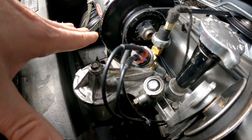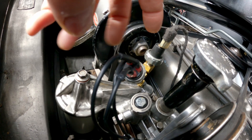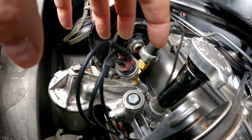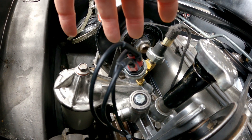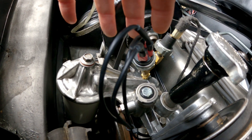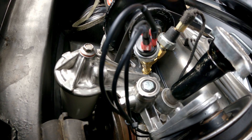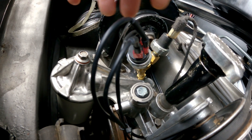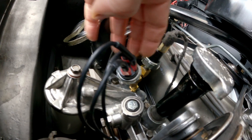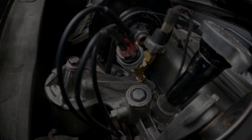The oil pressure safety switch has three poles: one sends a signal through a relay to power the pump, and the other two receive signals — one from the starter and one from the accessory position of the key. For safety, if you're driving and get in a wreck, the engine shuts off, you lose oil pressure, and the fuel pump shuts off automatically. For everyday convenience, every time you turn the key on and crank the engine, the pump turns on automatically, and when you turn the key off, it shuts off — no switches, no toggles to remember, just drive the car.